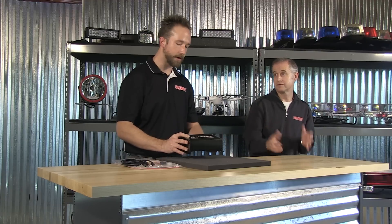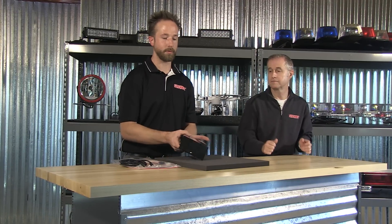So it's a dual amp? Kind of — it is. It's dual in dual tone and dual in functionality with normal tones and low-frequency tones. And it will work with a variety of different units. So you don't have to team this up with a Code 3-specific siren amplifier. You can team it up with other manufacturer systems to expand upon what you may already have in your vehicle.